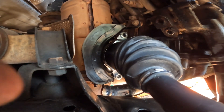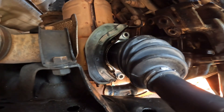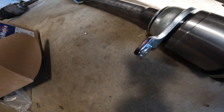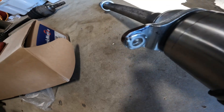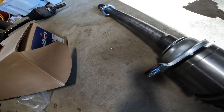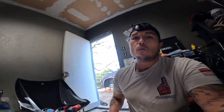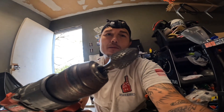So now I get to mark it, pull it back off, and shave that side of the ear down. There's what we got shaved down — we're going to take it to the side of the washer they got welded on there. There's more than one way to skin a cat. I got this carbide tip, we're going to try that belt sander — whatever you got, use it, knock it down. If you're running into this problem, use whatever you've got to take that metal off.